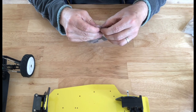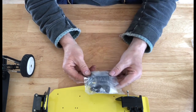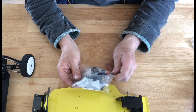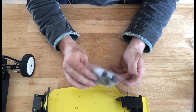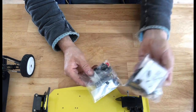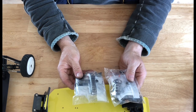And finally, your shock absorbers. Originally we were going to get all of the shock absorbers supplied already filled and ready to go, but our suppliers sent them all unbuilt and it was going to take another couple of weeks to get them all built. So the majority of the kits will come requiring you to assemble them — there's a little set of instructions in there and guidance on which shock absorber oil to use. They just need to be assembled and added onto the car. Very different springs are available — these are all Schumacher big ball shocks, available from the Mardave website or the Schumacher website.